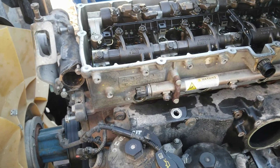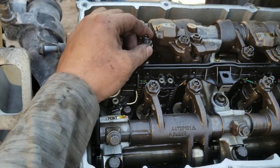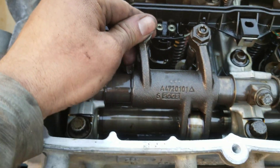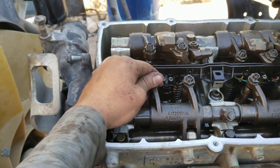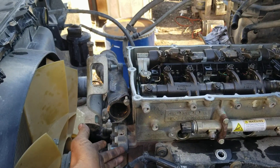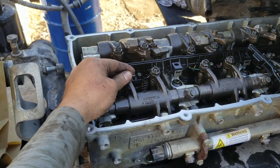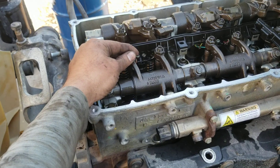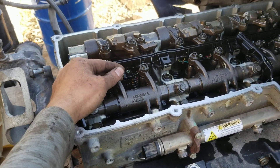Digging into this DD-15, I've got this engine at number one TDC, which means both intake and exhaust valves should have slack. If you look at the cam lobe, it is not on the lobe — it's on the resting place — meaning there should be slack. But there is absolutely no slack on this intake valve. What happens is the valve sinks into the head as the engine is being used, and if you don't do an overhead they have a tendency of getting tight. When they get tight they don't sit properly, and compression leaks past them and burns the valve and the seat because it's not really making a seal — it's staying open.